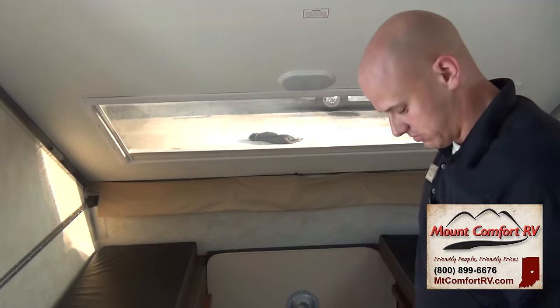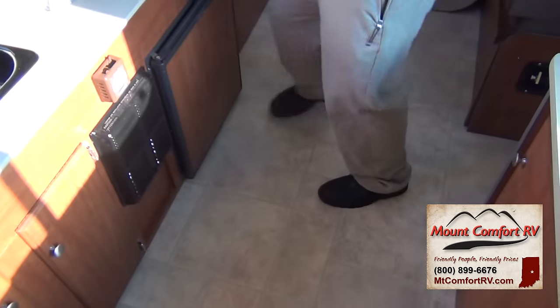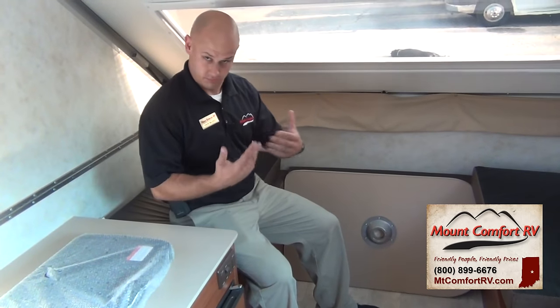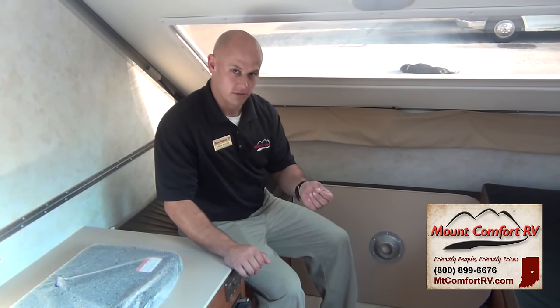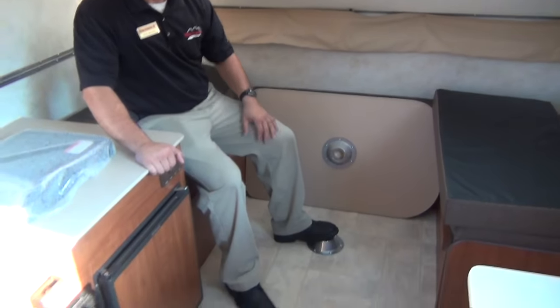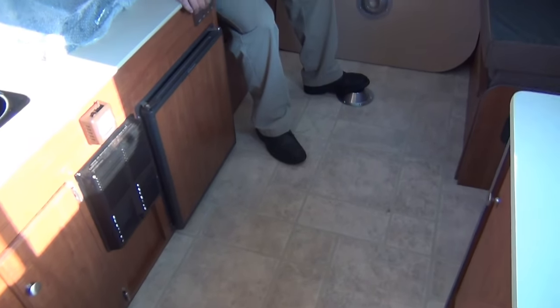What A-liner uses is what they call Performax 500 flooring. This is a flooring material they have soaked in resin to make it water resistant — waterproof if you will. If you've ever felt a piece of pressure treated wood versus a non-pressure treated piece, the pressure treated weighs a lot more because it's been soaked in resin to give it its water resistance. That's what they've done here. So you've got a nice thick piece of resin-soaked structural board that's going to do great against water, especially with that thermally bonded water barrier underneath.